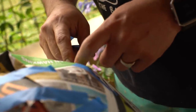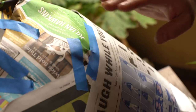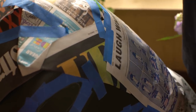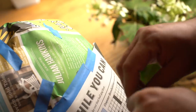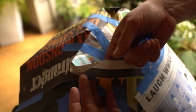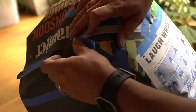Also, if you see a little seam right here where there might be some metal under there, make sure you tape this as well, because the paint dust will get into there. So don't forget those parts. You don't have to completely seal it, but just make sure you've got it at least laying down nice and evenly. Looks good. This is fine because this is folded from here over like that, so there's nothing open underneath there. So we can leave that.